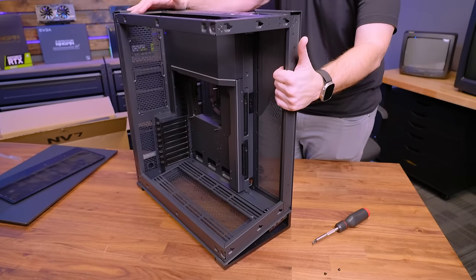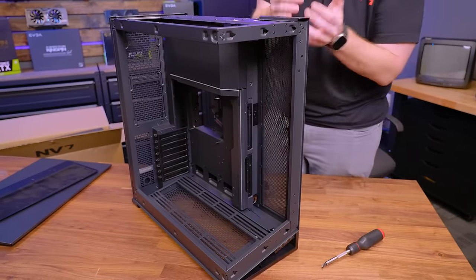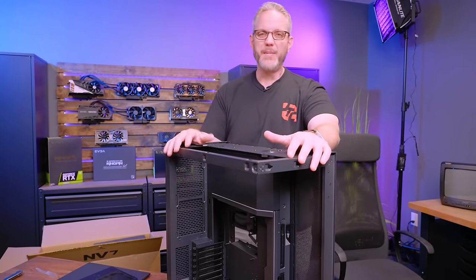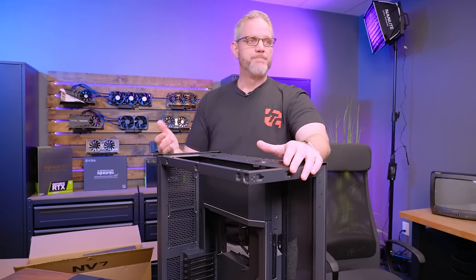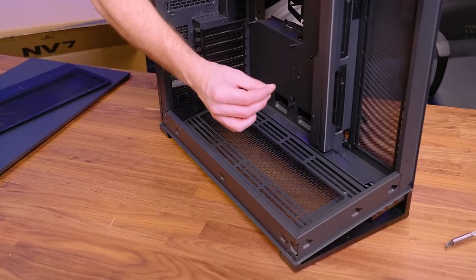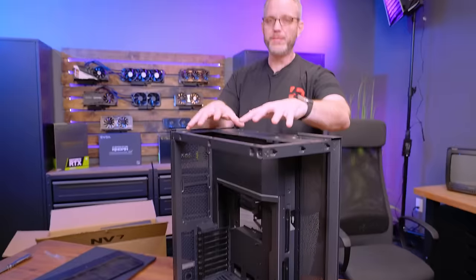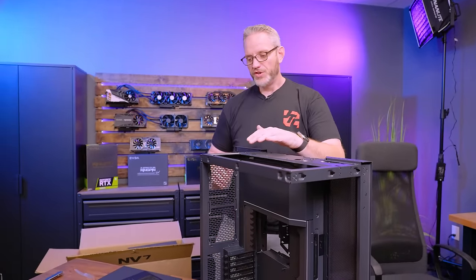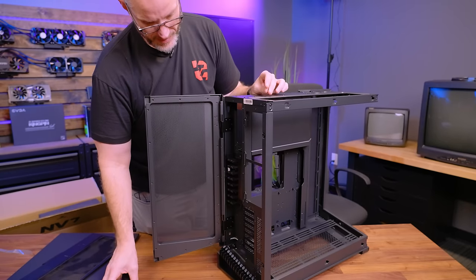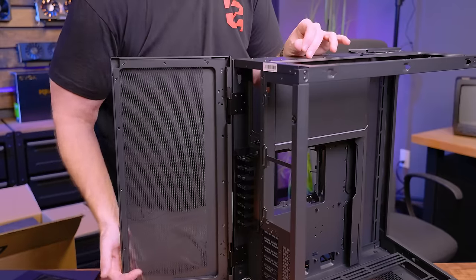Putting fans on the motherboard tray has become really popular with modern case manufacturers. You could have air intaking right there too, but I personally feel like that's not necessary with this design because you have so much intake on the bottom. Any fan movement overpowers the power of convection — convection force is very weak, but heat naturally wants to rise. So having intake on the bottom with all this free-flowing intake here without the super fine density mesh would free flow a lot of air up past your graphics card, up towards the top of the case and then exhaust it. The top has that fine mesh so it's gonna be slowed down a little bit, which means you probably want fans back here too.